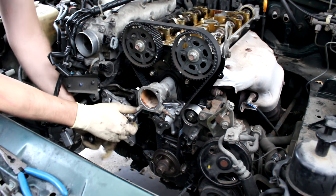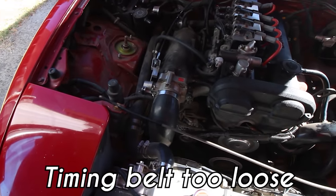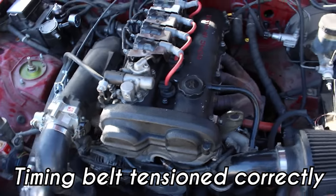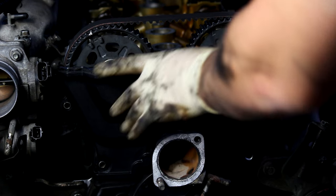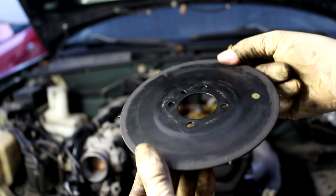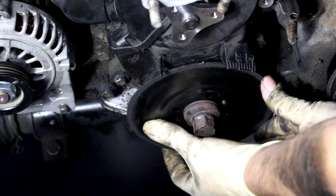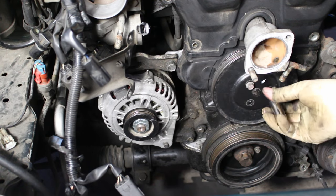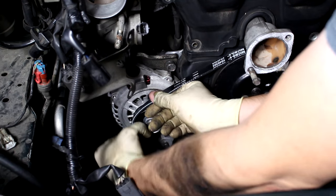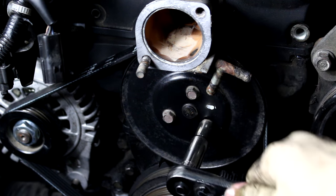If your timing belt is not tightened properly, your engine will sound rattly when you start it up. Let's get the lower timing covers put back on. Put the upper timing cover in place, but don't put the bolts in yet because of all the little brackets that hold the wiring clips. For the trigger wheel, do not put this thing on backwards — the part that sticks up in the center goes towards the harmonic balancer. Put your balancer on with four 10mm bolts. For the water pump pulley, thread those bolts in but don't fully tighten them until you put the belt on. After you get the belt all tensioned up and tightened down, then you can tighten the 10mm water pump pulley bolts — don't forget those.